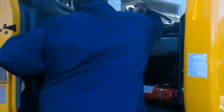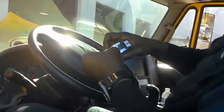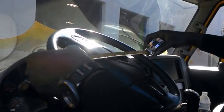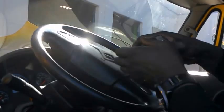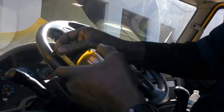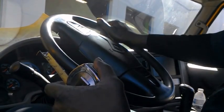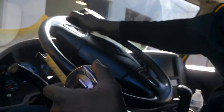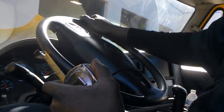It's going to be a long distance. I'm going to get in the cab and I'm going to measure the steering play in here. First thing you want to do is look up the manufacturer specs for whatever vehicle you're working on. Here's an 18-inch steering wheel and I'm going to make a slight little mark right here and measure the steering play. The steering play is 2 and 1/4 inches for this car, and what we have here is 2 and 1/4. That's great.